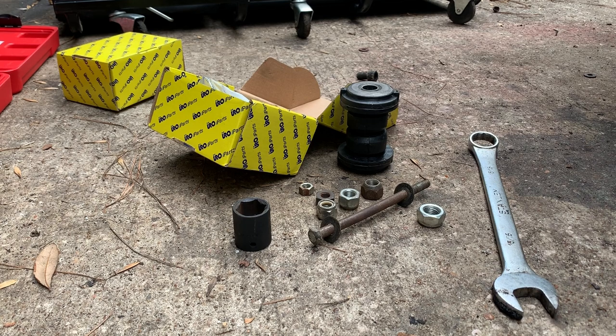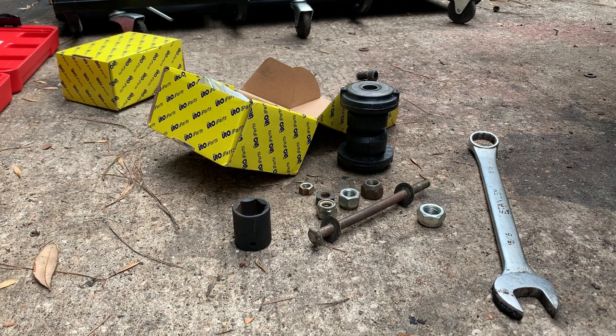I'll show you, they're squeezing rubber off. The passenger side one, other than the rubber looks old and cracked, doesn't look near as bad as the driver's side. The driver's side looks like the bushing is actually rotated in the control arm, and it's just a mess. So we're gonna go ahead and address that and try to get this thing a little better in the front end. It really doesn't seem that bad, but we're gonna fix it, and then I'll get the front end aligned.